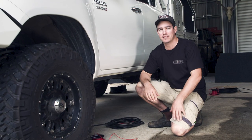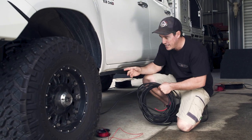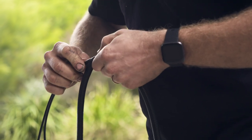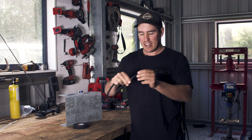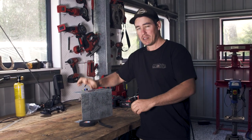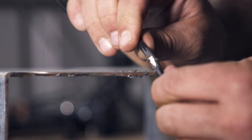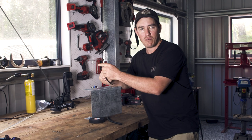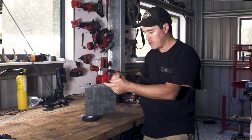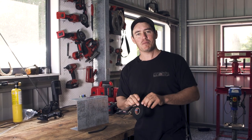When it comes to running cables, there are a lot of mistakes people make. One of the big things to do is run conduit on your cable, especially any cables going underneath the chassis — like this one going up the headboard onto the roof of the canopy and coming down inside. I really recommend conduit on just about every single wire going through your vehicle. Underneath the chassis, a wire that's bare on its own doesn't have enough protection for four-wheel drive use. Imagine something on the side of your four-wheel drive rubbing on a bit of metal — fast-forward 5,000 to 10,000 kilometres and there's already damage on that wire. The way to protect it is just feed some conduit over the wire and you're never going to have an issue. The general rule of thumb: if you're running any wires in your four-wheel drive, make sure they're protected with some form of conduit. It looks a lot neater, and more importantly, it's going to last a lot longer.